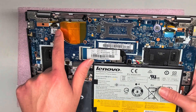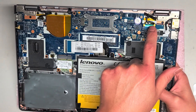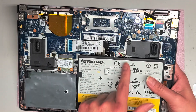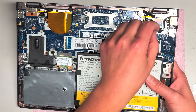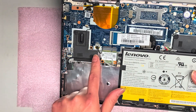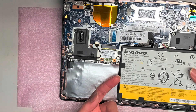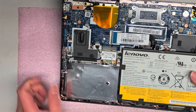Here you can see — I believe this is for the touchscreen, maybe the webcam or the microphones and cameras. You've got the LCD LVDS connector. If you are going to mess with this connector, make sure you disconnect the battery first, then press and hold the power button for about 10 to 15 seconds to drain any power from the board to prevent damage. You've got the charge port or DC jack here, which looks a little bit loose. One speaker here and another speaker here. Got the wireless card with two wireless antennas — you remove the antennas just by pulling up on the tails.